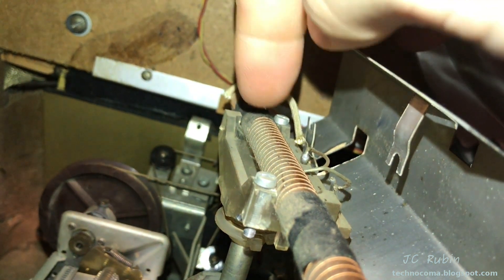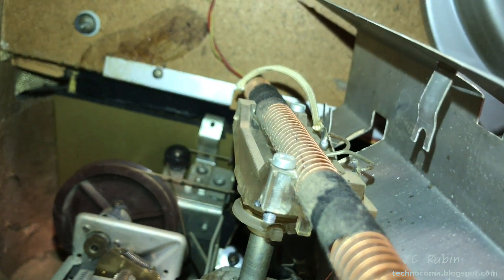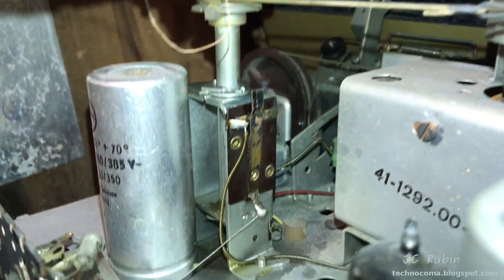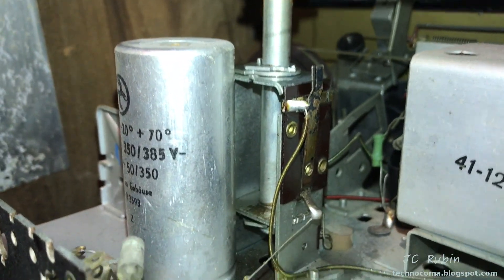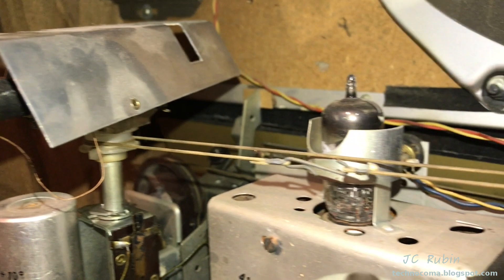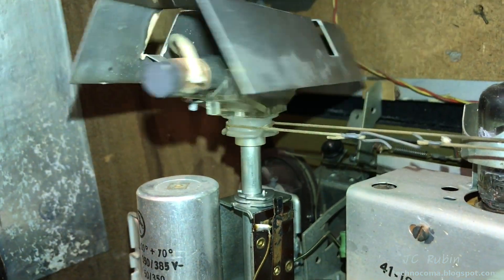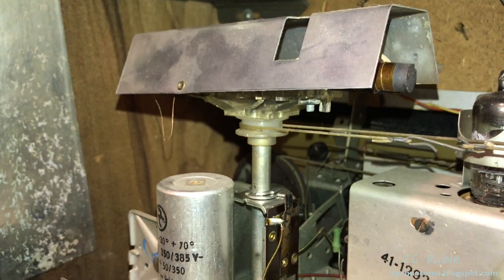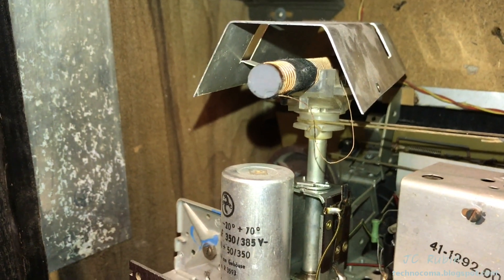It wasn't damaged — I checked the wire connector and it's just fine. It snaps back in right here, which I've already done, and this side simply seats. I'm putting the metal shielding back over it and this should be okay. Not only did I get it back together, but I lubricated both of these shafts with Rem Oil. There's actually a switch here that opens up when it's in the full open position. Now that I've loosened it up, this string actually works — it was just slipping and only moving a certain degree. But now it is working. We're turning it all the way, the contact opens, and when I release it and turn it the other way it comes back. So this is worth stopping and re-checking the radio.